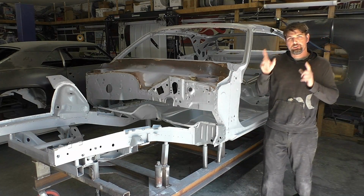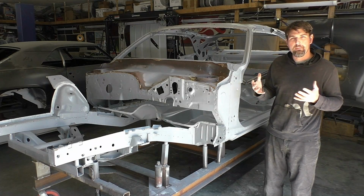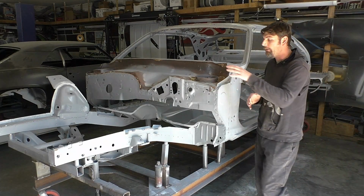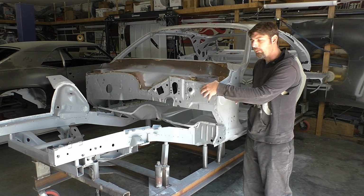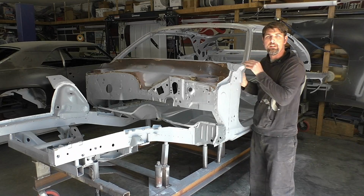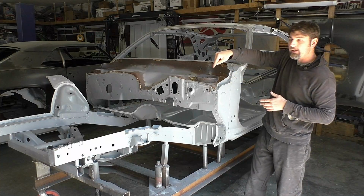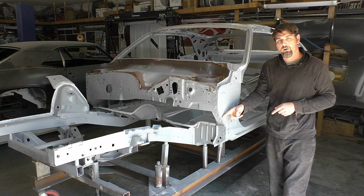We are going to start by stripping the panels that we have, the brand new parts, down to bare metal for the most part. We're going to get them ready to be epoxy primed. Hopefully on this video everything will be epoxy. I'm going to show you how, once we remove this old firewall that was holding everything together and spacing out the windshield in previous videos and jigging up our floor pan, now that we don't need that anymore, we're going to remove that. We're going to get this area prepped down, like I said, by fixing these side areas that are all rusted out.